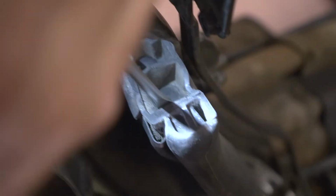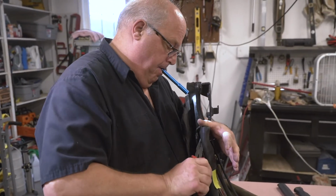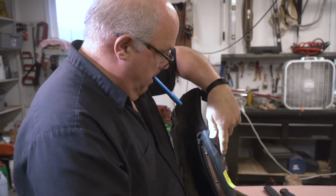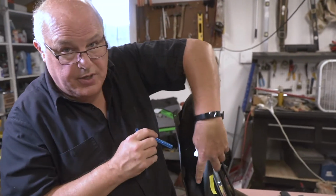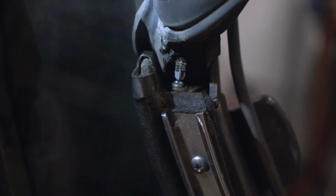On the underside of the B-pillar gasket, there were 2 Christmas tree push pins holding it in place. Robert got underneath the gasket material and pried them loose. Then it was just repeating on the other side. Christmas tree clip. See it there? And I can get under the second one too. Gently persuade that out.